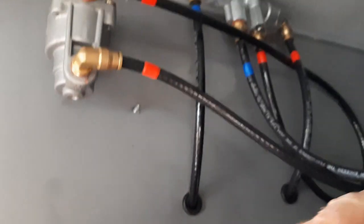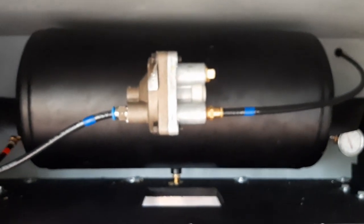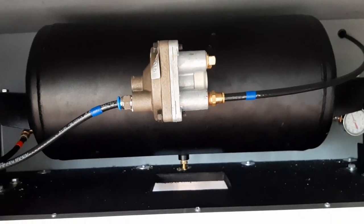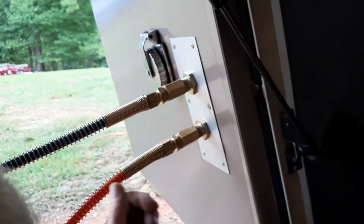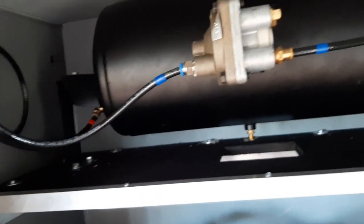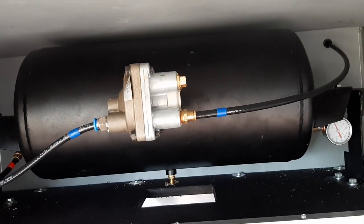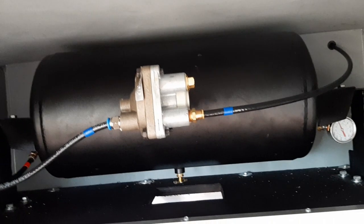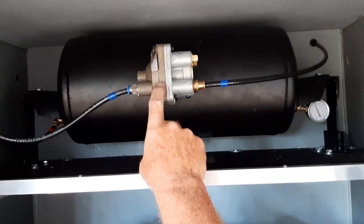The air comes in here and fills the tank. That tank is for the breakaway emergency brakes — so if one of these lines ever breaks or the trailer comes detached from the tow vehicle and snaps one of these lines, the brakes automatically come on. So you don't have that little wire attached to the hitch anymore? No, I don't.